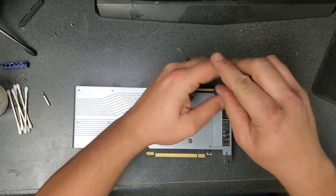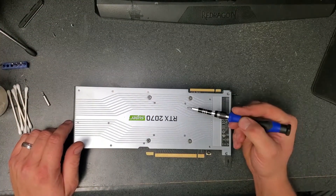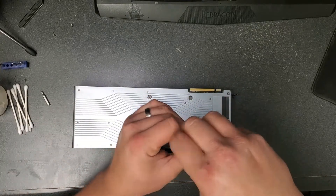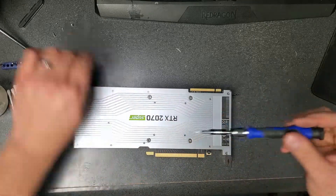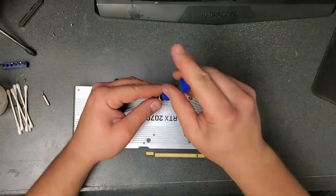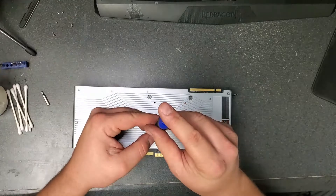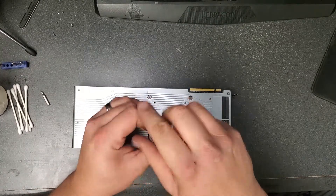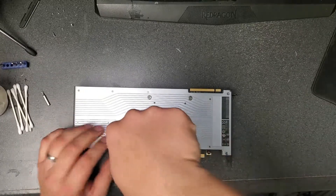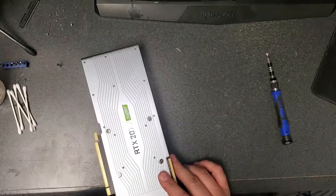To tackle this project, you'll need some Q-tips and/or paper towels, tiny Phillips head screwdriver bits, and rubbing alcohol — 99% isopropyl works best for cleaning thermal paste off the unit. Hopefully you won't need any new thermal pads; they usually take a long time to wear out. As long as they're solid and not crumbling into powder, you can just make sure they're back where they belong and they'll work fine.